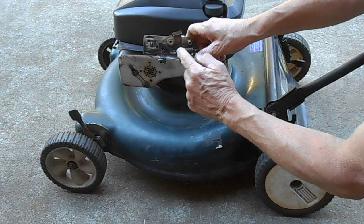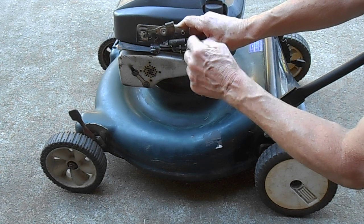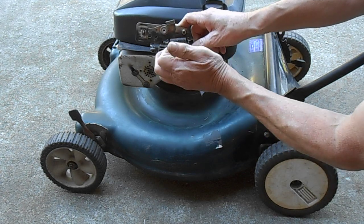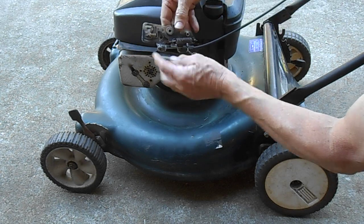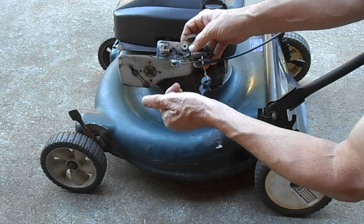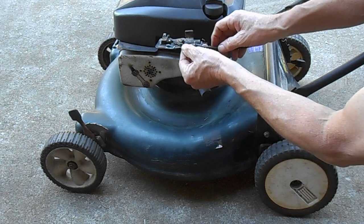Here's what the switch looks like on this mower. I've removed this spring - you got to take some wire pliers, it's best to do it on the mower, but take the blower housing cover off and then get some pliers on either end and get that spring off. Then you need to move this cable by squeezing it with some pliers and back it out, so you remove this cable. All you're left with is this switch and the brake no longer really plays a part - you're just taking the spark away from the engine.